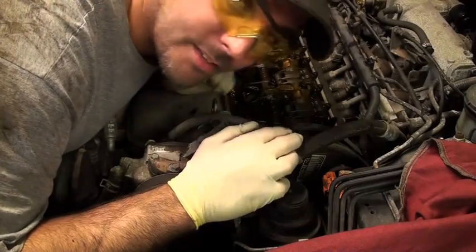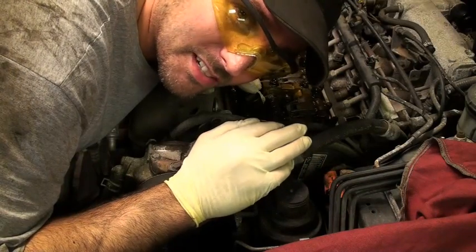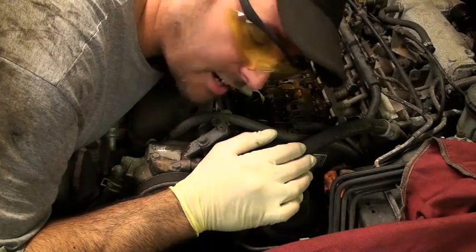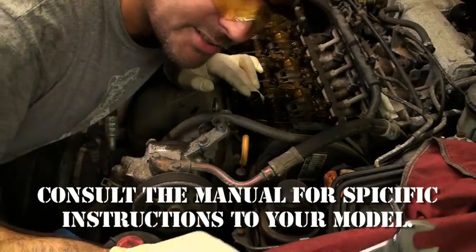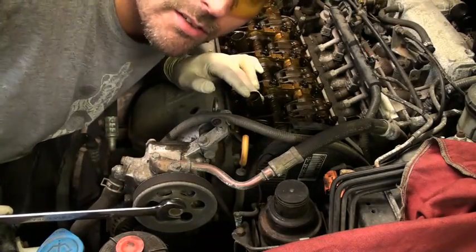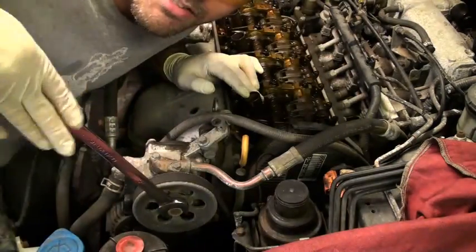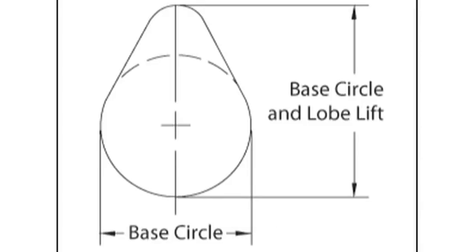Here's how you do it. First off, the engine needs to be cold. The valves need to be cold. The very best time to do this is first thing in the morning when this thing is stone cold — that's when these valves get adjusted. Some other vehicles the valves get adjusted when the engine is hot, but this one is a cold valve adjustment. Now you need to be able to turn the engine over. I took the spark plugs out earlier so that I could put a wrench on the power steering pump and turn the engine over very easily.